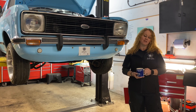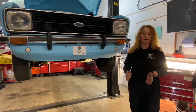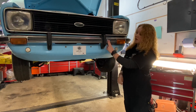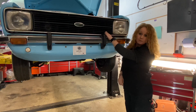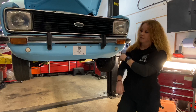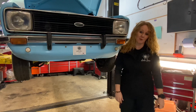Just to show you what I'm doing for the time lapse so you know what I'm doing. To take the bumper off you've got 13mm bolts — one on each in the centre but access is behind the bumper — and then you've got two 10mm bolts on each indicator, so they need to come out as well. Then the bumper can come off. That's the first job to do.